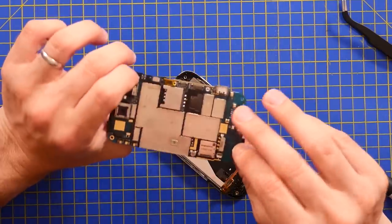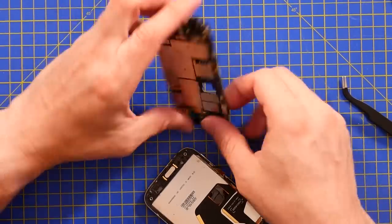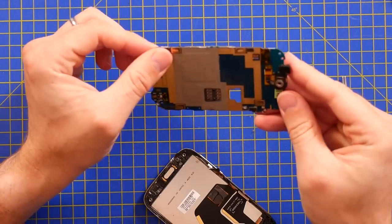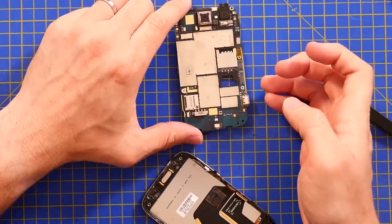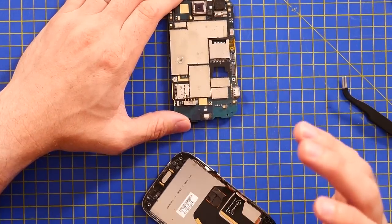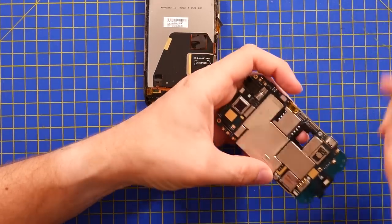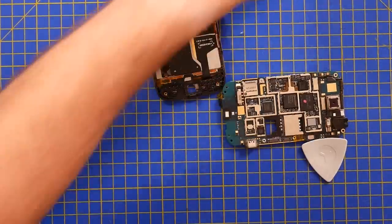So that's the main board. Do you see the SIM card? It takes up an enormous amount of space on this PCB, both the insertion side and on the rear. What's also interesting is we've got one, two, three, four different RF shields on here. Most of what goes into a smartphone now is integrated onto the system on a chip — the SoC — and that's contained as much as physically possible to simplify and reduce package size. These RF shields look to the naked eye like they are just clipped on rather than soldered on. Definitely just clipped on.